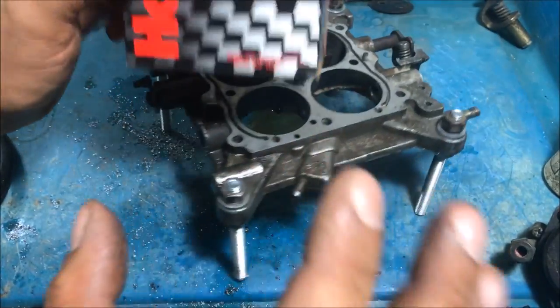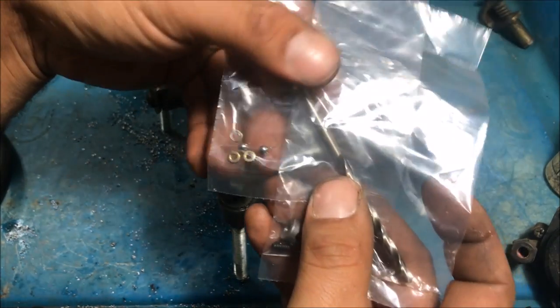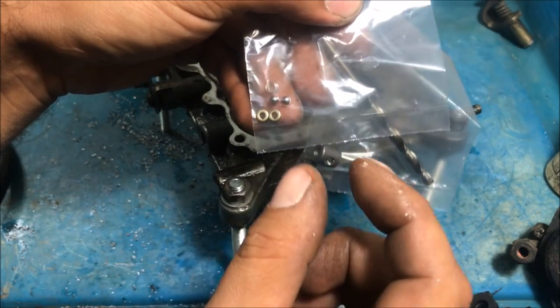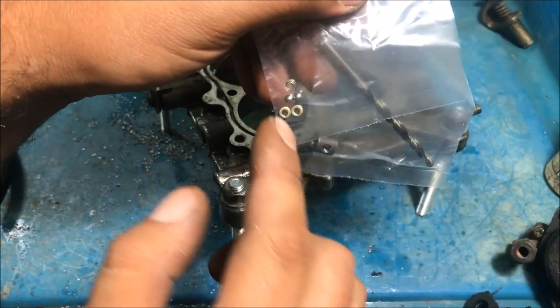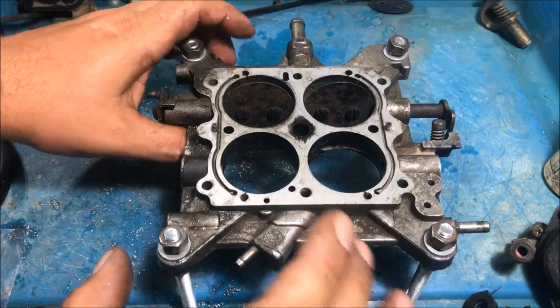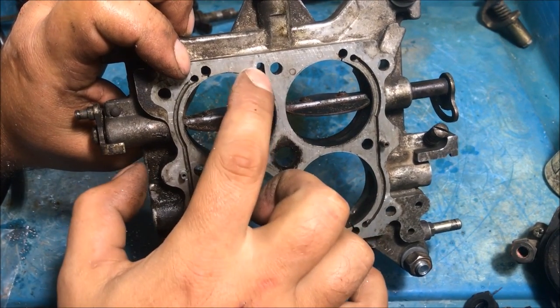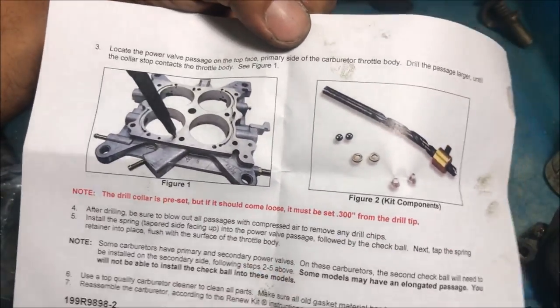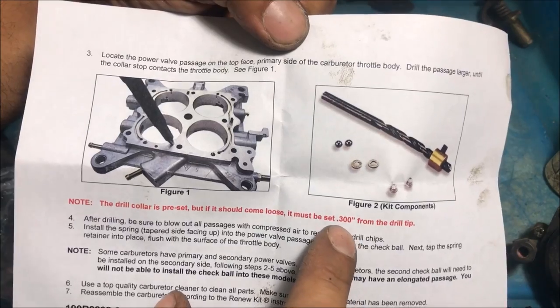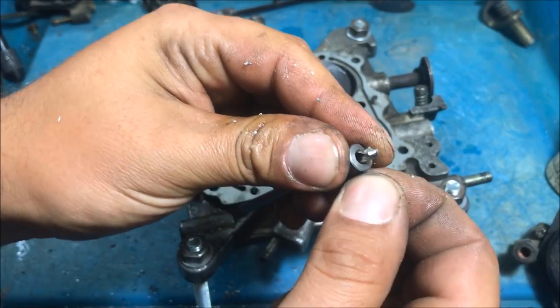Now let's check out the check ball power valve blowout kit — this was about $17, and notice I buy everything from Holley. There's another one that AED makes. I bought this Holley one because it comes with two, and these are different from the AED version which is a fixed little valve housing piece — this one is just springs, check balls, and little lock washers. In this carburetor we only have one power valve in the front. They say you can't use this particular Holley kit on elongated holes, but the AED ones work on elongated holes.